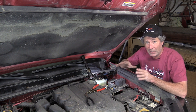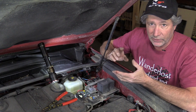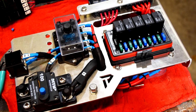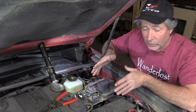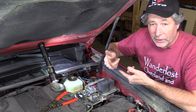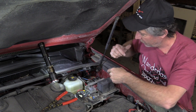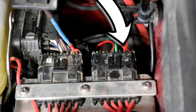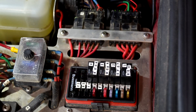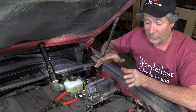Now we're ready to put some power to it. Early on in this 4Runner build, we prepared ourselves for adding on extra lights, air compressor, all that stuff, by building a custom relay and fuse panel. We'll put a link to that video in the description. Something like this makes it extremely easy to add on anything — all I need to do is literally just plug the lights into this. The black wire or ground from our lights gets grounded to the chassis or body. The red wire, or positive, comes down from our lights and gets plugged in using one of the same kind of connectors we've been putting on our other plugs. Then in here, we have a relay and a fuse for it already in there.